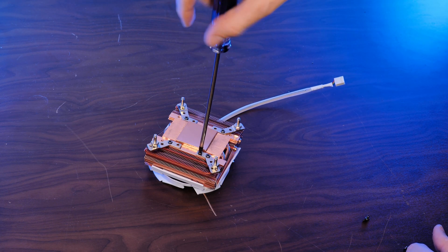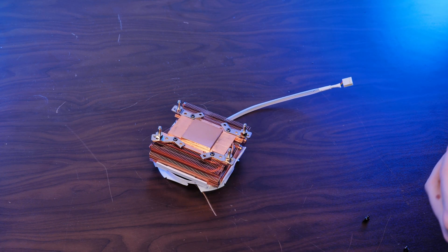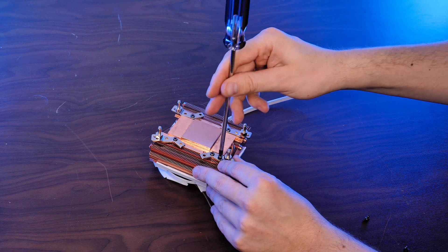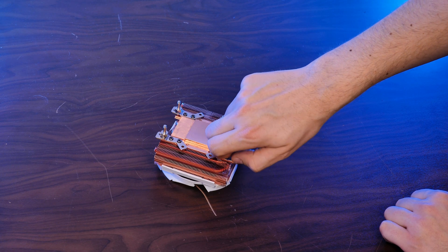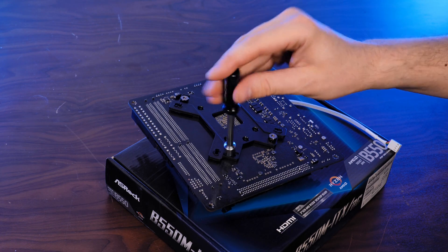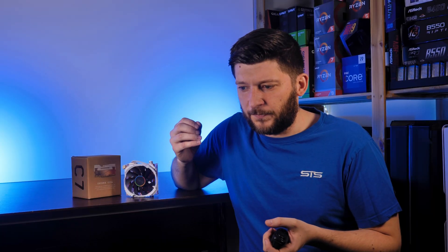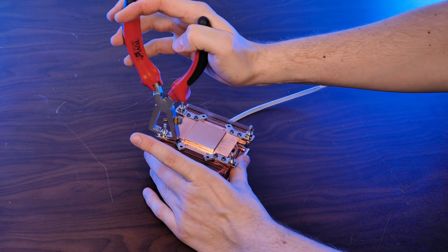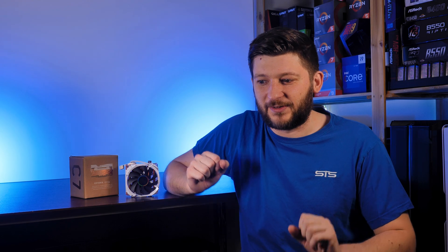For an AMD CPU, Cryorig created a heavily thought-through mechanic. First, remove the screw closest to the center of the cooler on each rail, then flip the rail so the other hole aligns with the hole inside the cooler. Then remove the pre-installed screw and install it in the other hole — the outermost ones for AM4 and the top ones for anything else. From there it's the same procedure as Intel: thermal paste, position, back plate, screw down. One issue: the protruding screw part is too long to fit the nut tool, which is annoying.